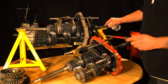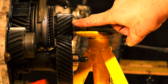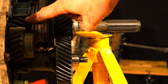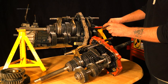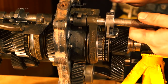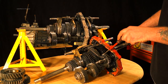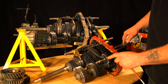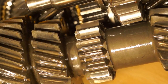Now the difference between the two gearboxes: on the R380 you have your 5th gear on the rear like the LT77, however you have your reverse gear with an idler here and synchromesh in between the two — so reverse is on synchromesh. Whereas the LT77 down here doesn't have that. It has an idler which you have to select and push into place, and it's not on a synchromesh — it's straight cut gears.